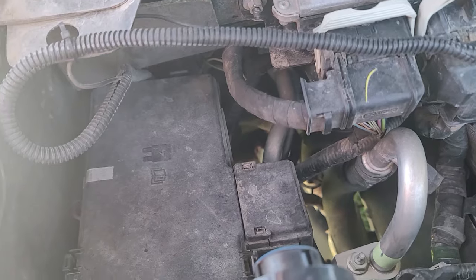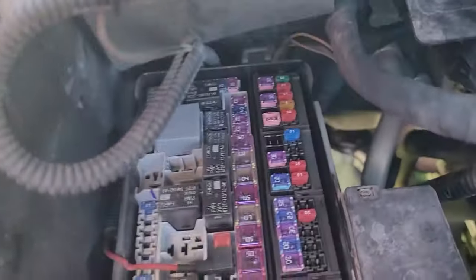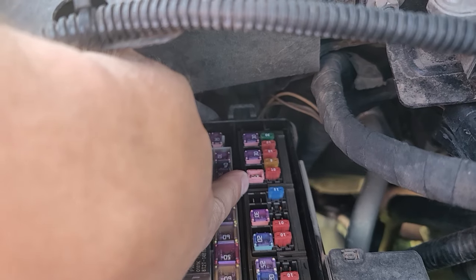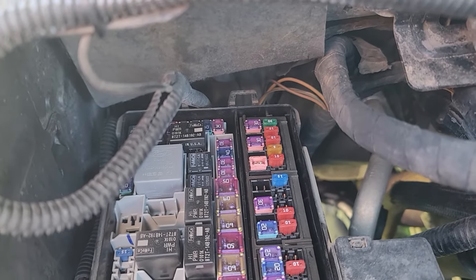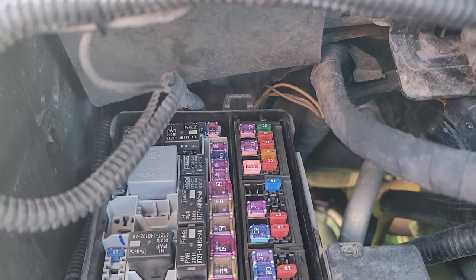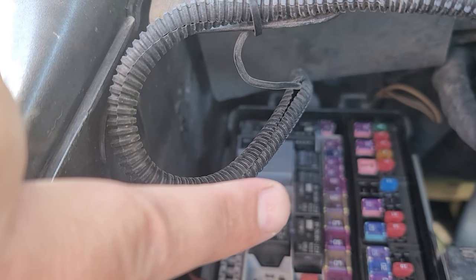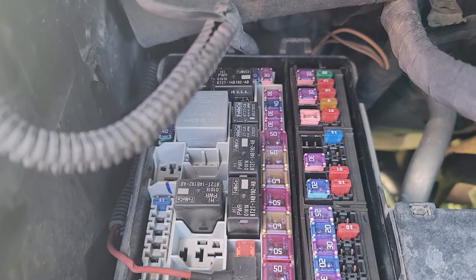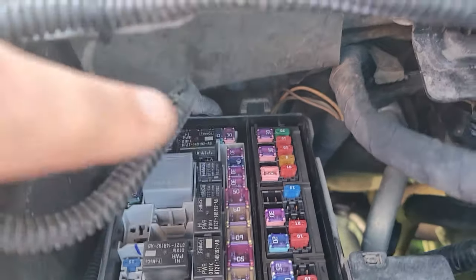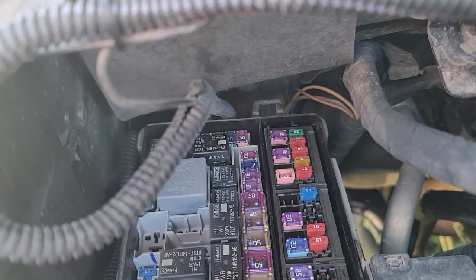Back under here is my fuse box. If you open up this fuse box, this standard box fuse here is a 30. I tried to take the fuse cap off and it broke, so I need to replace that fuse. That fuse is responsible for my fuel pump — that lifter pump I was talking about. The problem is Ford, in their infinite wisdom, did not add an external serviceable relay. Underneath this is another relay that's non-serviceable, and apparently these trucks get hot and melt a wire that destroys that relay.